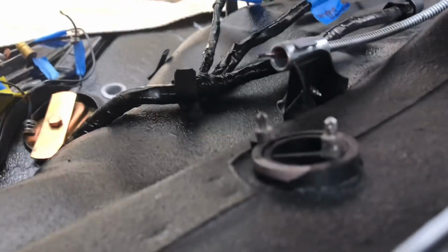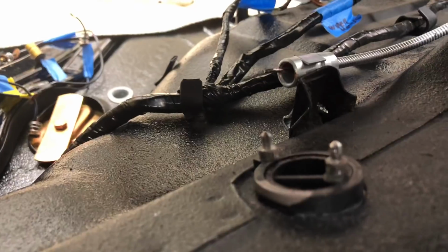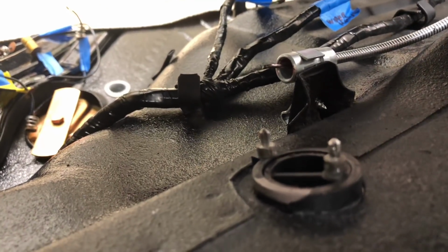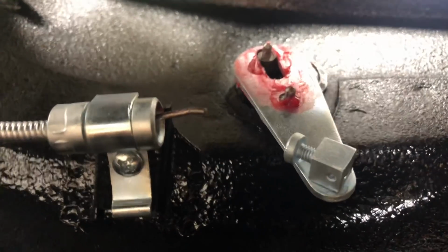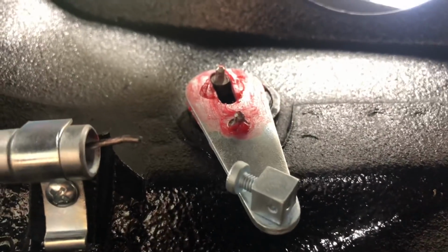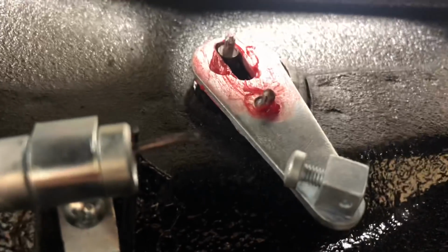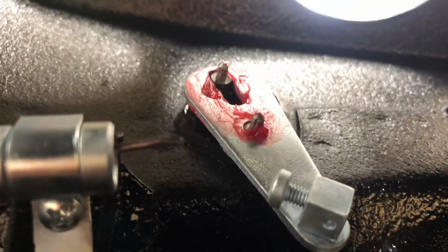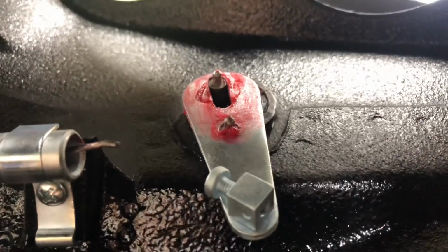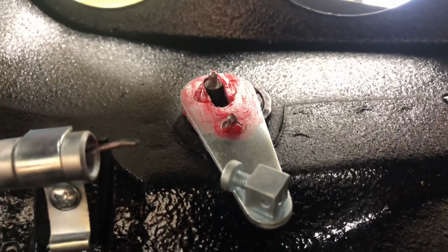That's fastened off. Okay, let me lay out the bracket that goes on there, and then there's a right order for the spacers and the washers. So we got our brackets sitting on top of there. You're going to want to grease the top and bottom, also the cam slotted area, and the hole that the two studs come up through there. Everything is in constant motion, so good lubrication there will probably help save your switch.